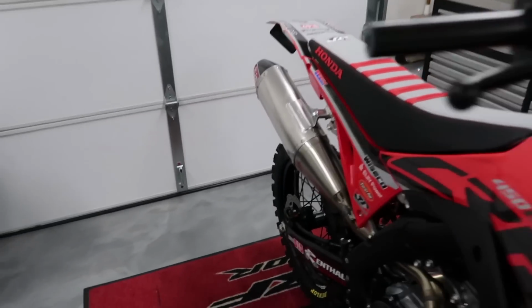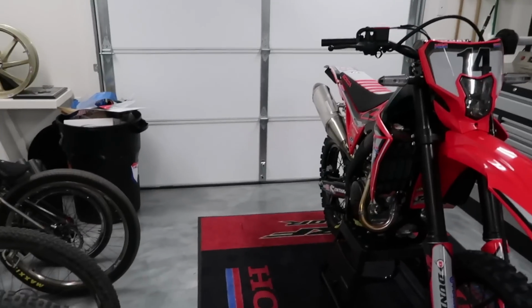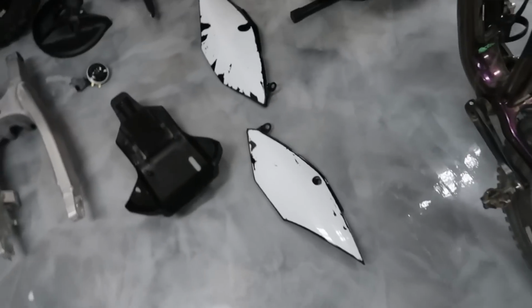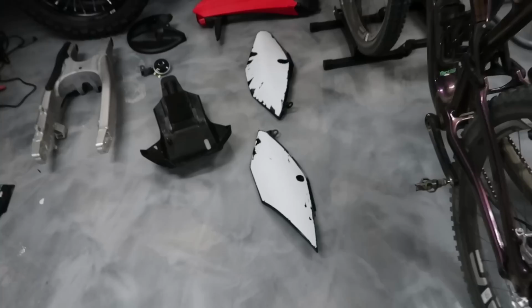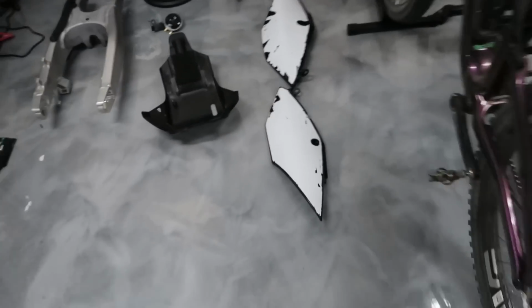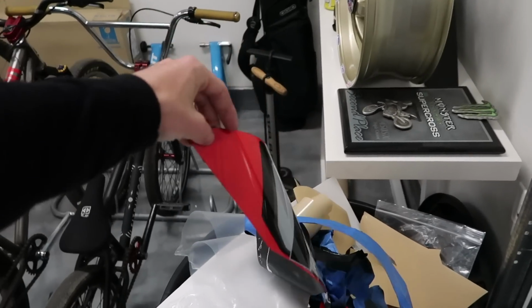And as I said, I was kind of embarrassed by the way I got those number plates to be black, and you probably guessed it. And I'm probably gonna get roasted in the comments for this, but I tried. And as you can see, they were spray painted, and the plastic spray paint just didn't bond good enough with the plastic, and everywhere that the graphics stuck, it just peeled up right away. Like I stuck it down and this happened. Spray paint on the back of the number plate.